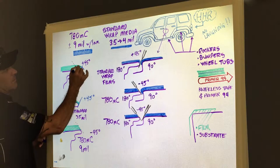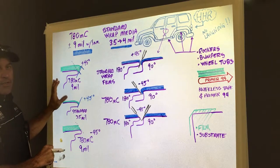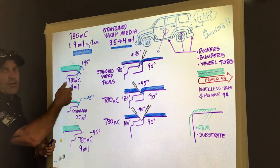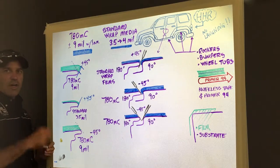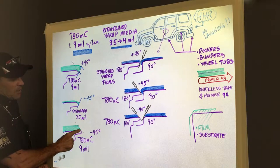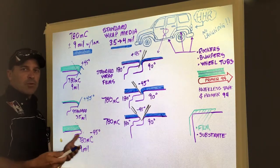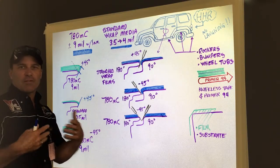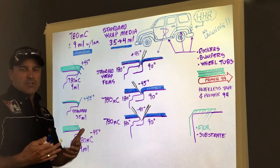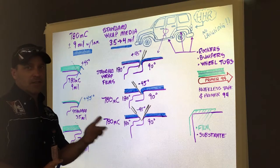You can get a hold of this material on the turn and actually start creating some lifting simply with friction. With the thinner film, that doesn't happen because there just isn't enough of a lip there. You should also understand that reflective film is not paint or color change film — it's reflective — and it's going to behave differently than standard wrap films. There are going to be behavioral differences between standard wrapping films, digital medias, and reflective films, because of the density and thickness required to build the retro-reflective mechanics into that material.